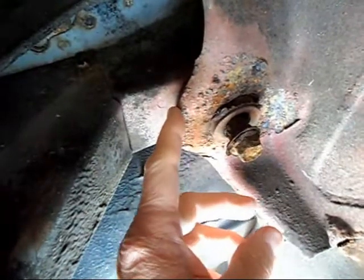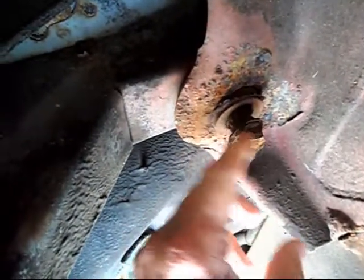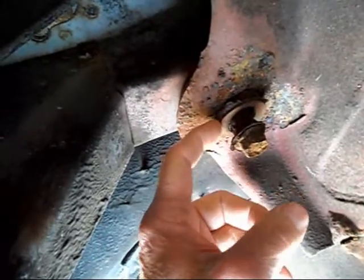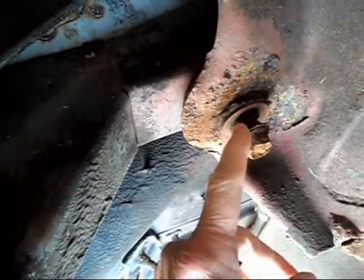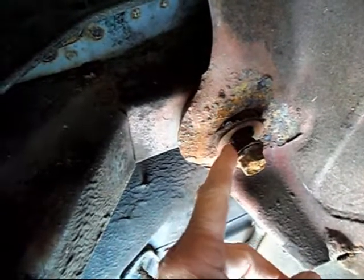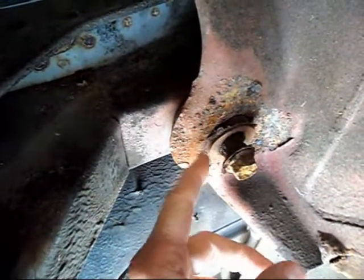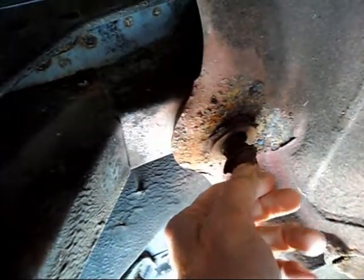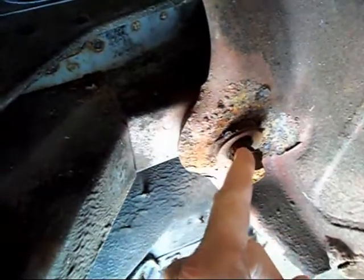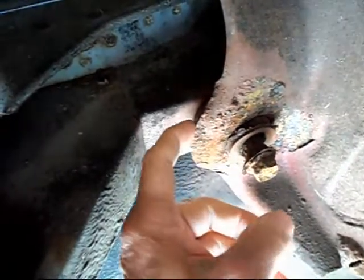This is the left rear cab mount, the driver side rear cab mount. This bolt is solid, but as you can see everything is gone here and the other side is the same way. My dilemma is I'm not going to even attempt to take this out unless I can be very, very sure I can get the right things to go in here. I've never done this and this is a job I probably would not even attempt myself. The problem is you try to remove this, which is solid, the nut is not accessible from the top. It's in this closed channel right here and it's probably one of those captive nuts, which will break loose and just spin around, and then you've really got problems.